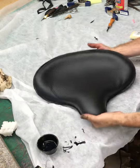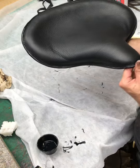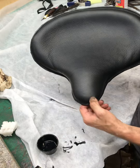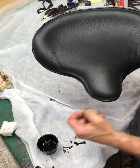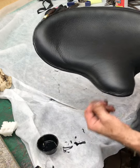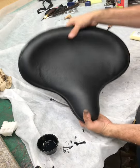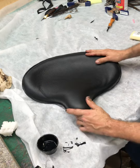There we have it. One new leather tractor style seat, recovered, stitched edges. Could also do this with a laced edge if you wanted to, after you clamped and let the glue set really well, maybe overnight. You could go ahead and punch holes or lacing slots through the edge and do a simple whip stitch with a heavy leather lace, or use a flat thin lace and do a nice decorative edge braid. That would look real good. A lot of different things you could do. The key really is that a nice heavy but soft, flexible leather works the best for this.